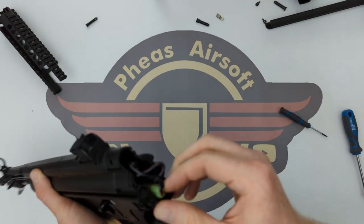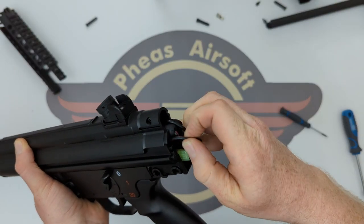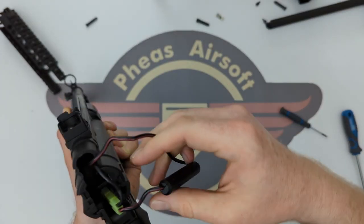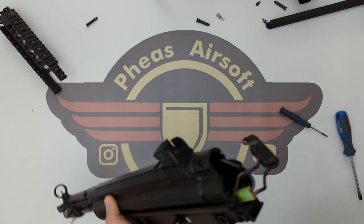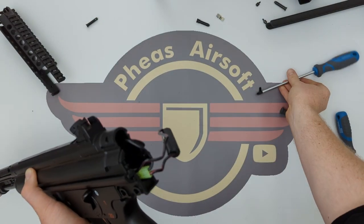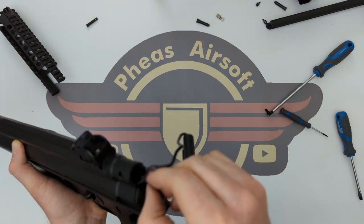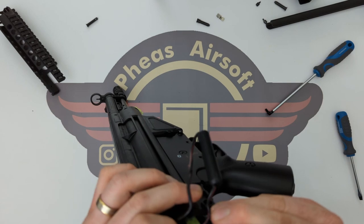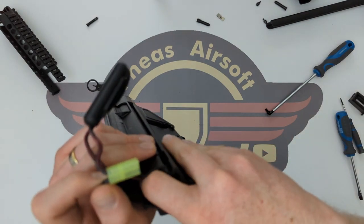The wiring is coming out the back — there is a Tamiya and a fuse holder. If I pull the fuse holder out first, that gives us access and we can see these wires should be going down there. Let's get a Phillips head in there, release that, and there's a little plate. It is literally a mini Tamiya onto a mini Tamiya — just released those apart.